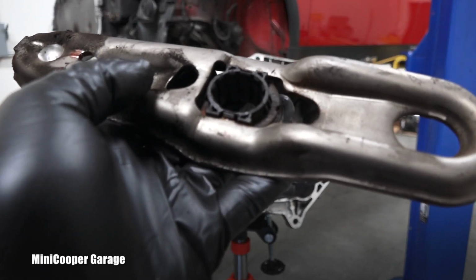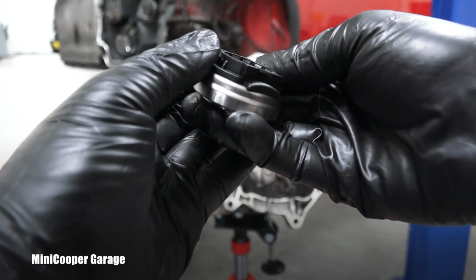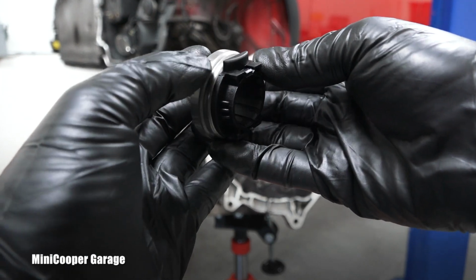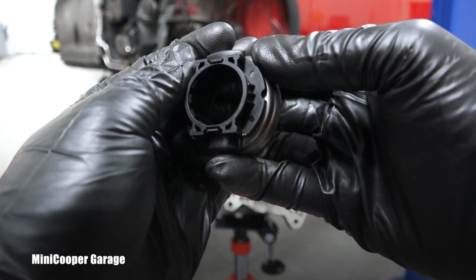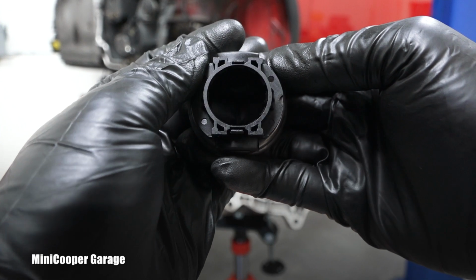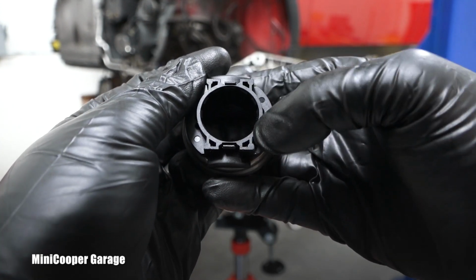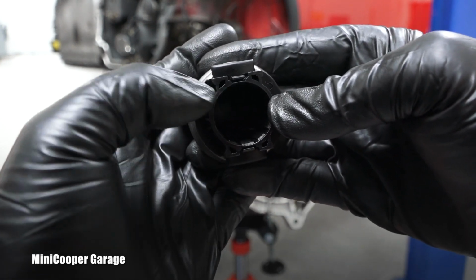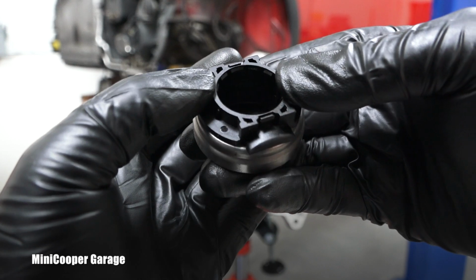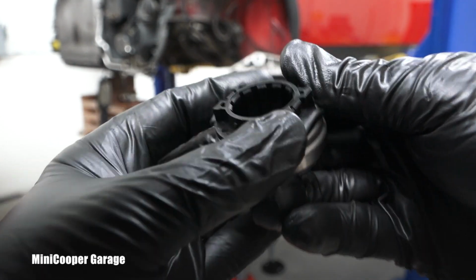from this lever. That reminds me of that little trick which every mechanic uses, right? If you are not sure how to take things apart, many times you will grab the brand new part which you are installing, and that will show you, or give you a clue, how to remove it. In this case, I just wanted to show you those small clips on the back of that throwout bearing.